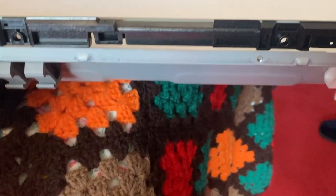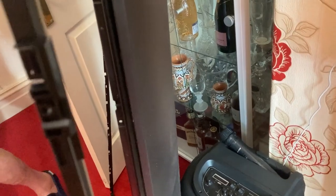We can tape those boards to the panel before we lift it off. Once the LCD panel comes out, the frame all around it just has little clips to pop off, and the frame can then lift off to expose the filters.